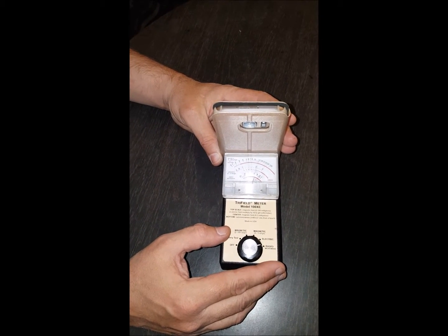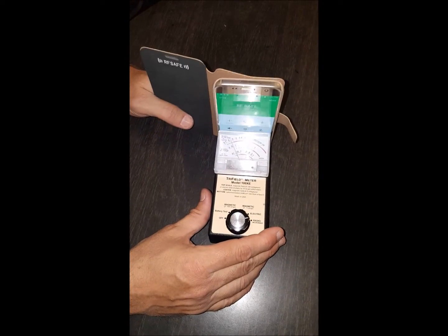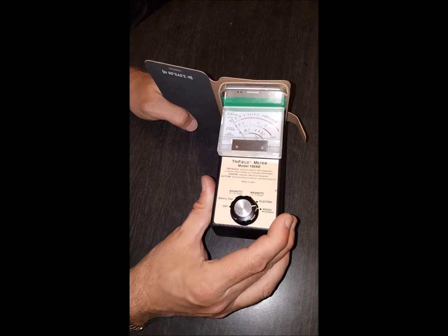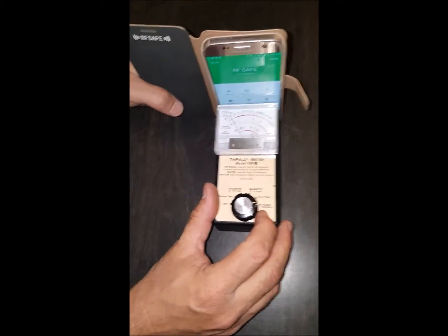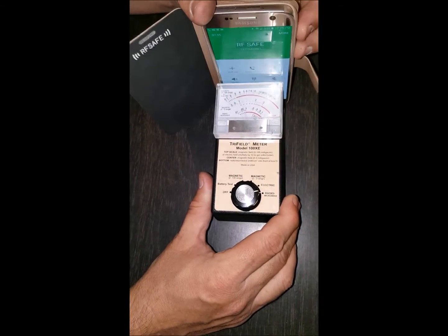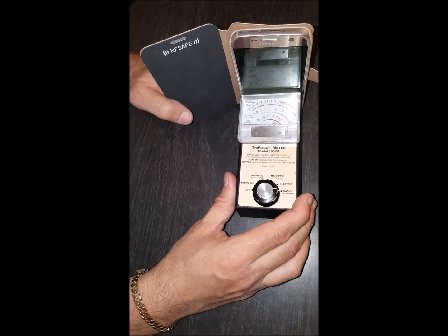We're really disappointed to tell you that this particular phone has a simultaneous SAR rating now higher than the iPhone 6S and 6S Plus. We are on the magnetic or radio wave setting on this meter, so this is only picking up microwaves, not the E-fields from the screen. We can confirm this by turning the screen off — the readings are still just as high, so this is actual microwave radiation.